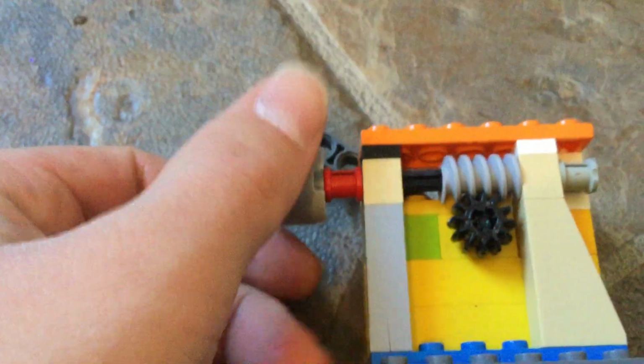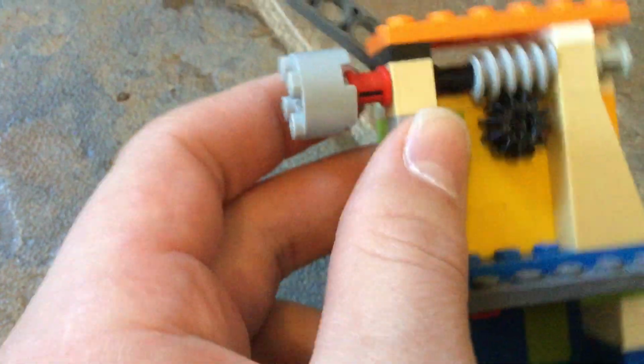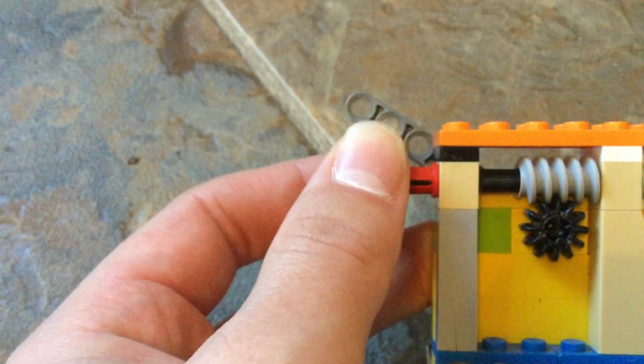So you can see that's as far as that's going to go unless I turn the worm gear and it bottoms out later. So you can see the throttle arm moving when I'm turning this. So that allows for semi-precise adjustment of idle speed on the go.